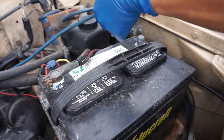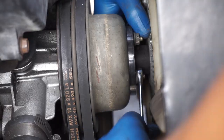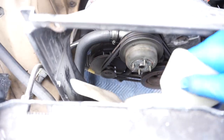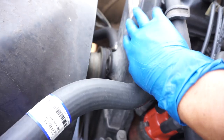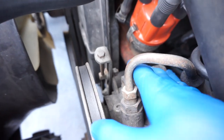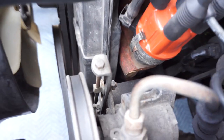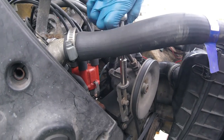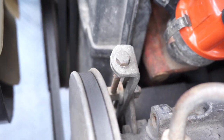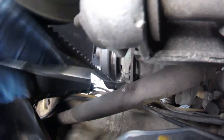First I'm going to disconnect the battery. You have to remove the fan housing and the fan clutch using these four bolts off the hub — it slides off. Then I can loosen up the pulleys, pull the belts off, and have access to the timing cover. I'll start by loosening a 12 millimeter bolt, then a 10 millimeter bolt to loosen up the pulley. There's another 12 mil and a tensioning 10 mil bolt that also need to be loosened up.